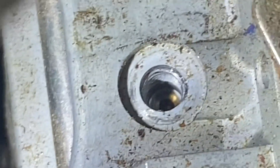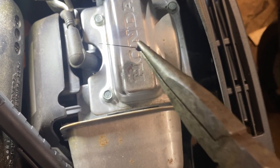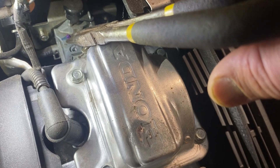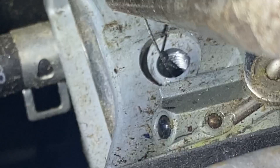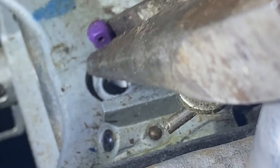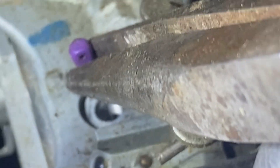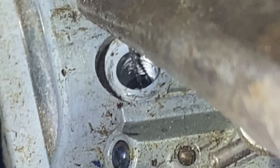Once you open it up, there is the inside of that hole — you see that brass jet. I'll show how I cleaned it. I'll be using this purple dental file with my long needle nose pliers, and basically you want to kind of drop it right into the center. I also noticed after zooming in how dirty it is in the surrounding areas. So basically go in the center and push that through a few times to get that brass jet clean.